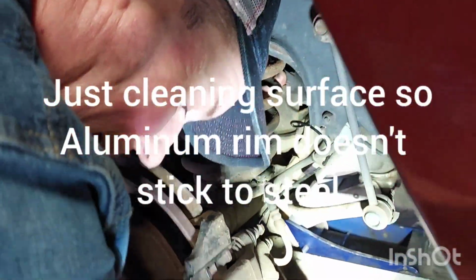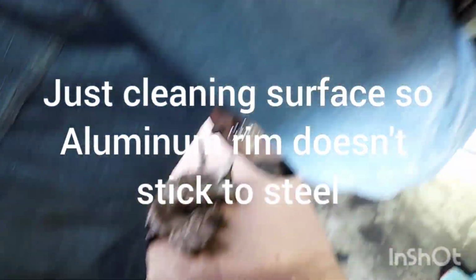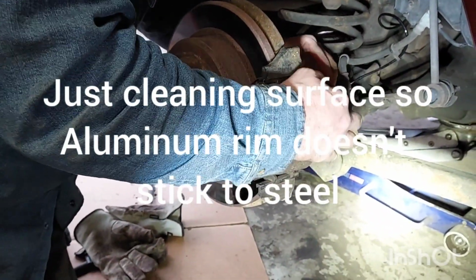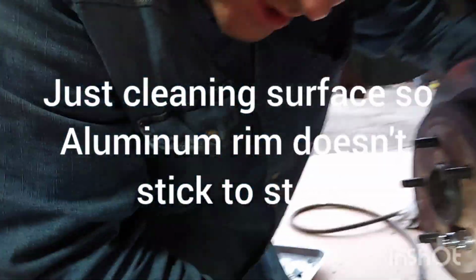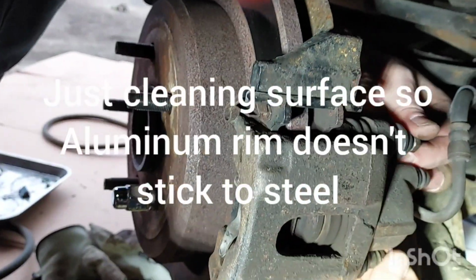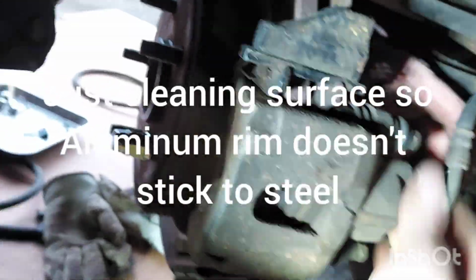I'm gonna start these by hand. I don't wanna mess this across right now. These are a little tricky to get lined up, but you can't really see. Fix this rubber boot and get this where I'm going. Best I can. So I'm wiggling, I'm just doing it by feel. I'm wiggling these bolts and getting those started by hand. As long as you get it 2-3 threads like this, I can go crazy.